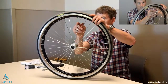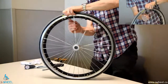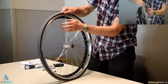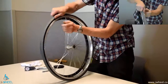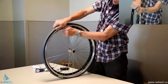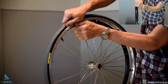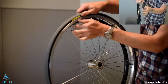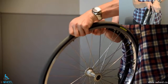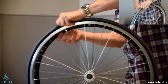Now, you see it's still pointing away, so I want the tyre to move this way on the rim and drag the tube with me. I'm going to change hands because I'm right-handed — to get it perpendicular again. You might need to take a couple of loops, and you have to make sure that you've got no air in the tube, because you're overcoming friction all the way around and it's a little bit difficult.